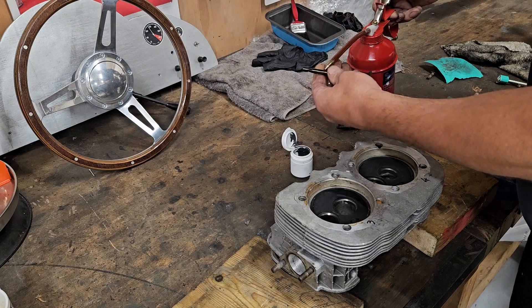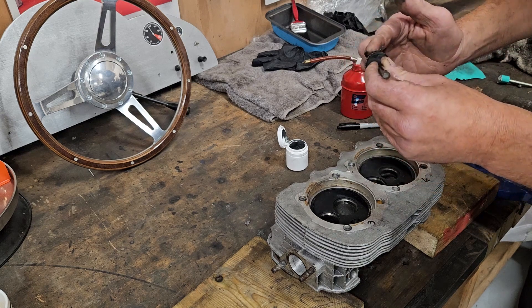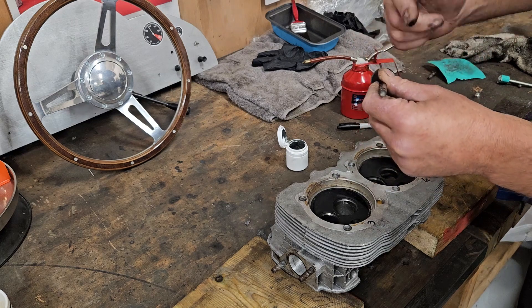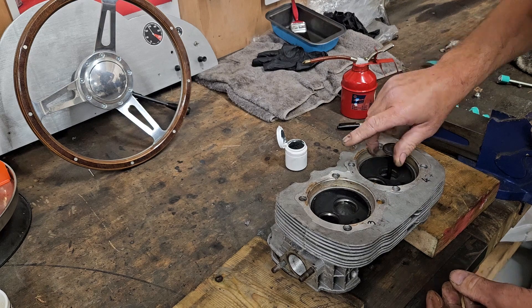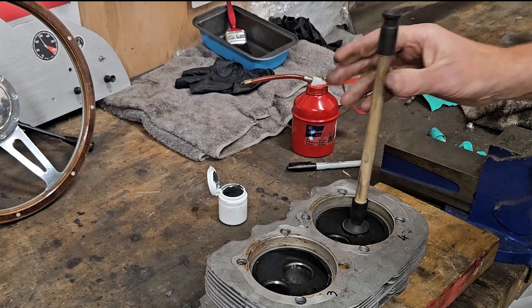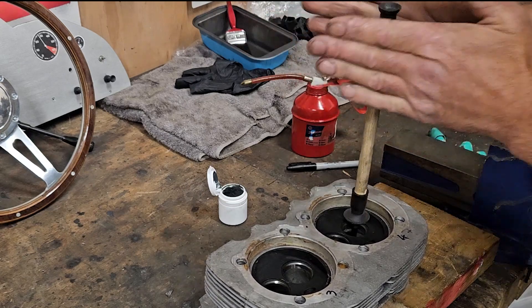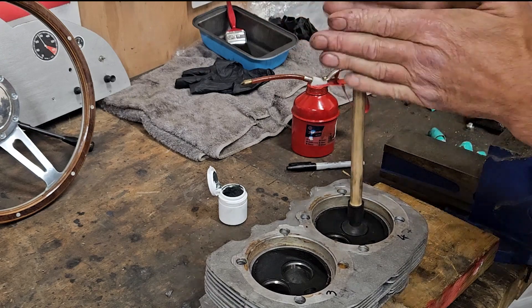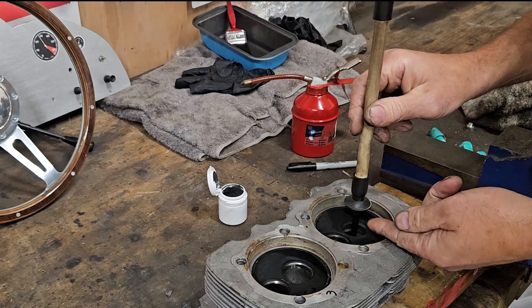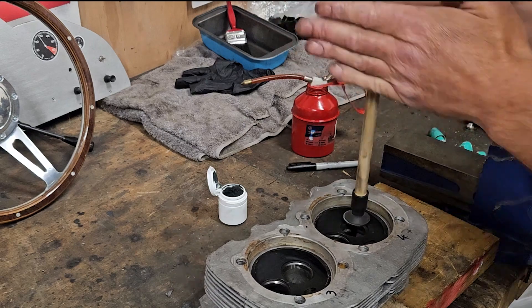Time to get the valves lapped in. I'm going to lube up the valve and put a drop of fine grinding paste onto the exhaust valve. We don't need a heavy coarse paste because the seats and valves are really good — they just want a little tiny cleanup. We've got our magic twiddly stick, and all we do is lap — go left, down, right, up, move it around. What that's doing is cutting a very fine face on the valve seat in the cylinder head and on the valve face itself, making a perfect gas-tight seal. You can hear the graininess of the paste, so it's actually cutting.